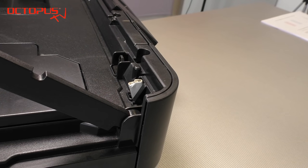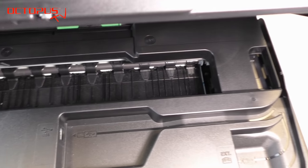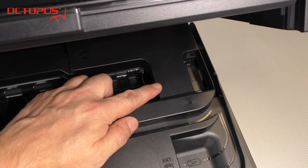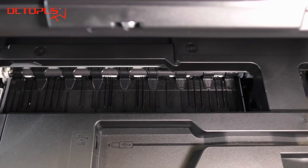With that little roll bridging that switch, the printer thinks that the upper lid is actually closed. Our aim right now is to get the printhead out of the parking position into the middle of the working area where the printer actually prints on the paper.